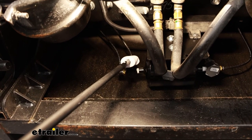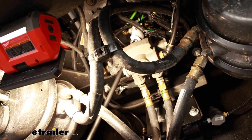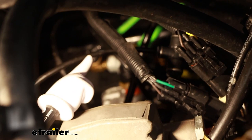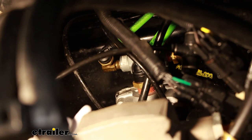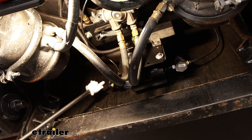That's your supply — put that T in. For the metered air line, these are push-connect fittings, so make sure they're all properly seated. Push them down, make sure they bite in. You'll see a black hose right here — it's a little bit larger diameter, looks to be about 3/8-inch. Cut and put your T there, and this is going to be the smaller diameter T in-line, very similar to that supplied air. Do the same technique using the tubing cutter and clean that off, then route this line down to the metered air. Once you've routed the line that goes to the back fitting, that's going to tie in here. With all those connections made, make sure your tank is tightened down.